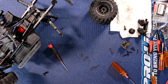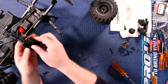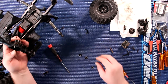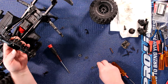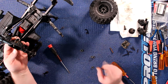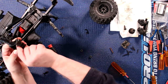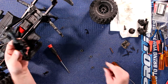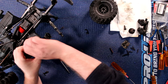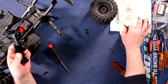Grab the tag for the 511.4 and put it in the bag. Re-grab the case. The bigger bearing goes inside and the smaller one goes outside right here. Pop that one in, and the smaller one outside. Then let's grab the pinion and put it back.